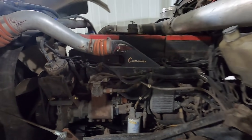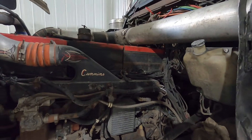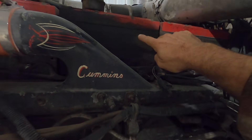I don't usually make how-to videos, but today I'm going to be running the overhead on this Cummins N14. First thing I need to do is gain access to it, so I'm going to take the intake, the valve covers, and the jakes off.